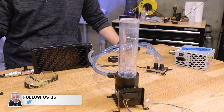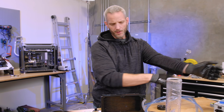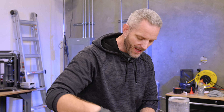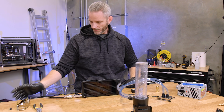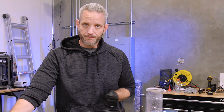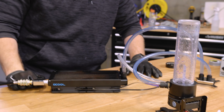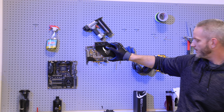A video I've never done but always wanted to: how much pressure can a loop hold? This is inspired by something that happened with Nick and me a couple years ago. I was showing him with a thermal imaging camera how a radiator works — it's a double pass, goes through one half, turns, comes back out. On a thermal camera you can see that temperature gradient change color across the rad and see the split right down the middle. I was using a heat gun on the radiator to heat it up, one of the tubes popped off, and we got like a 10-foot geyser of water up to the ceiling. When fluids get hot they expand, and when they expand past the bursting point of whatever's containing them, bad things happen — kind of like opening up the radiator on a car.